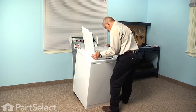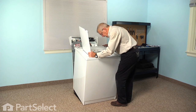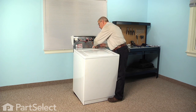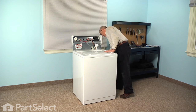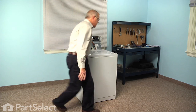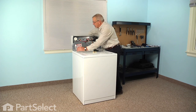So we'll lift the lid up so that we can view down inside. We'll tuck that lip underneath first, line up those 2 front slots with the tabs, and then just carefully tilt the cabinet forward. We'll need to pull the back panel into position, get the water injector in underneath the main top, and then align the tabs at the rear, and just pull outward on that cabinet when it's fully pressed down to make sure that we have it locked onto the base.